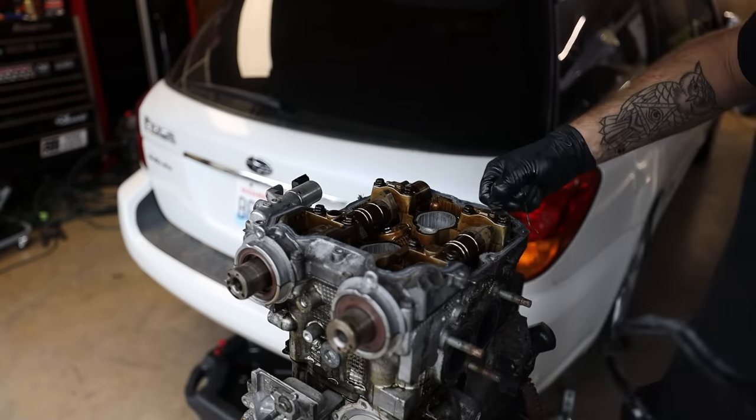He said he first noticed when coolant temps got around 230. And then he kept an eye on it, and it just kept going up to 250. Like I said, 2 to 3 miles on that, it'll demolish an engine. Anything past 212 degrees, pull the car over, shut it off, and see what's going on in that engine bay, because that's not normal. Thermostat opens at 185 degrees, your fans kick on at 205 degrees, and as soon as your fans kick on, they should start bringing temperatures back down.